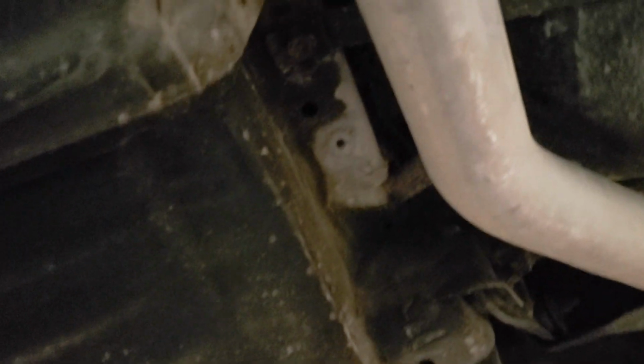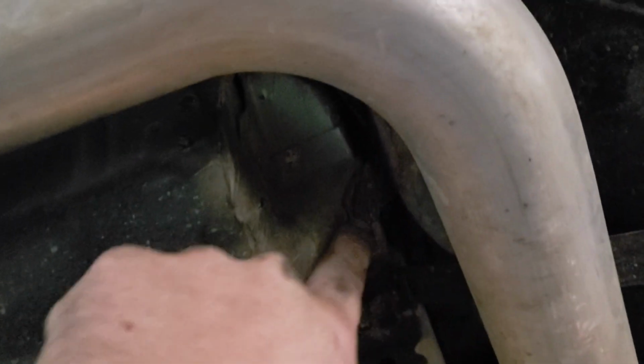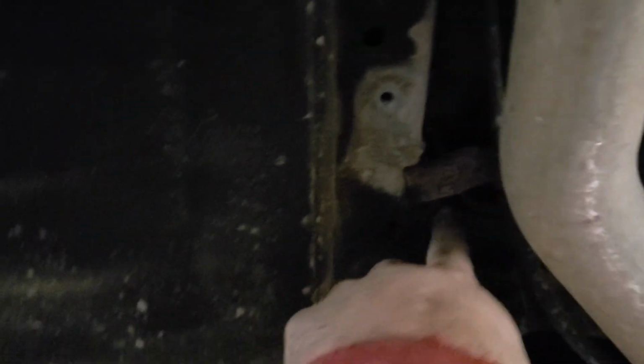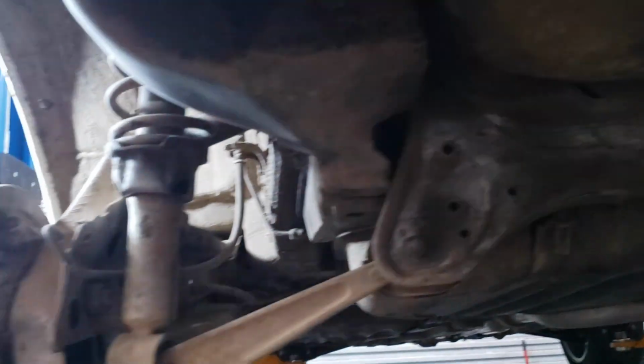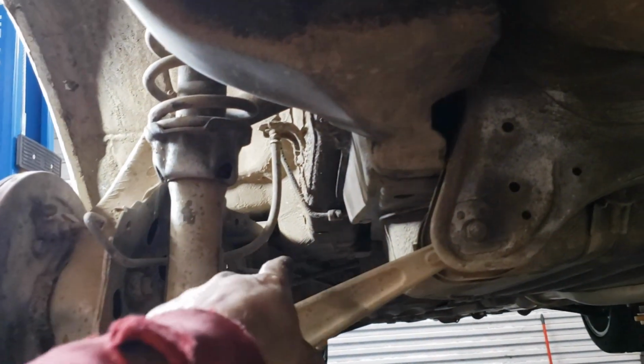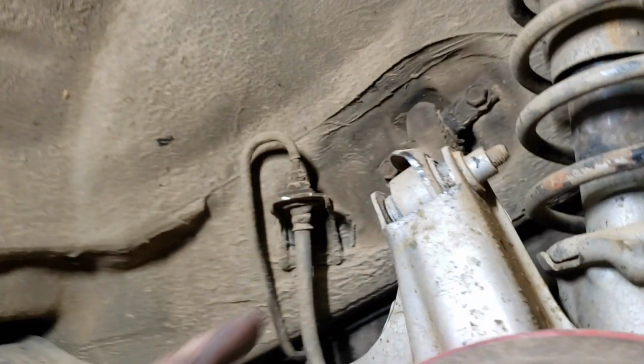Yeah, and then on the passenger side one, since we're not going to be actually filming that side, it's kind of the same deal with the cables. Got a 12mm here holding the cable over there, and the bracket right here also has a 12mm on it, and then those go over to that side. Yeah, so it's just this 14, the 14 up front on the toe link, the two 17s on the trailing arm bushing, and then the 14 here.